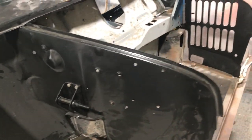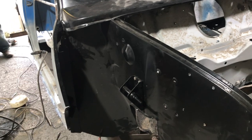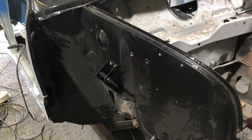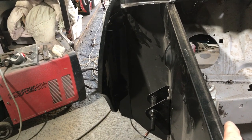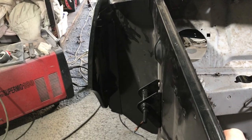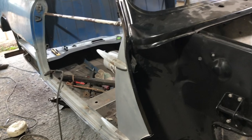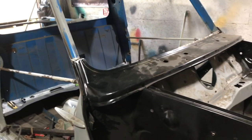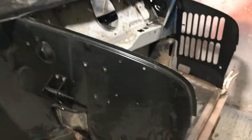You could drive it now. A lot more work to be done on the front end, but the bulk of the hard stuff's done - we've done front ends before. Got to do all the welding of the inner A panels yet, but we'll get the doors back on tomorrow, double check the alignment. Always worth putting your doors back on, keeping an eye out for anything moving. Still got routes to do and sort, but that's another day.